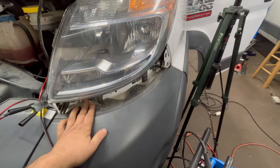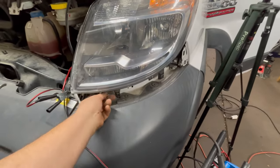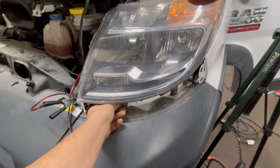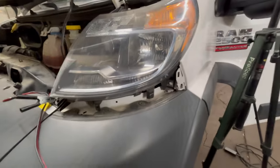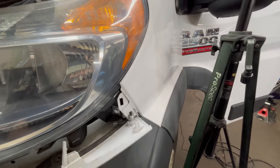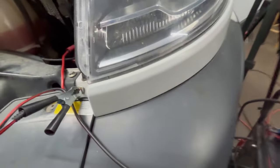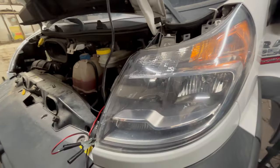It's very rare that you need to do this because they just point forward — what would they do, point cross-eyed, Google-eyed? But if you've had damage or something, you can turn the outside of this independently of the inside — that's the basic gist of it. When you're done, these just push into those receivers there, comes around the front where the bolt grabs it, give it a slam, and you are done. And that, my little freaks, is how you adjust the headlights in your ProMaster.